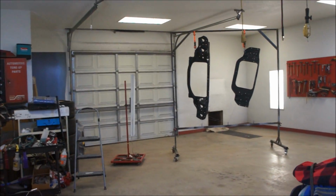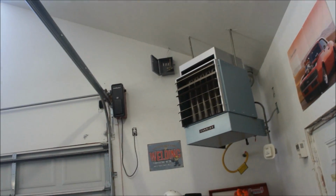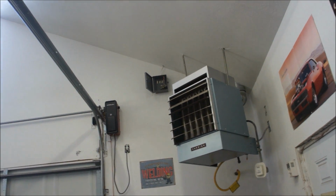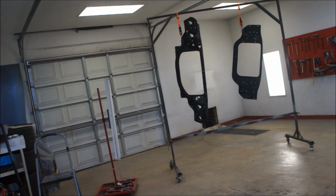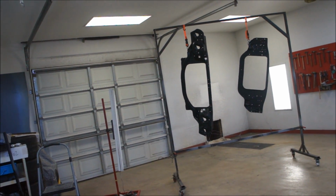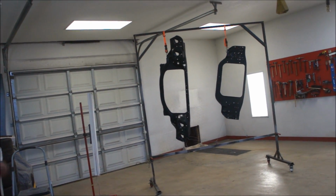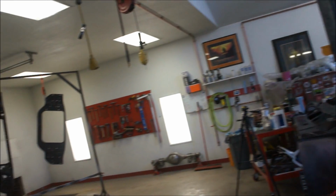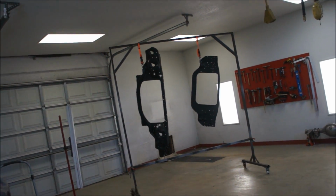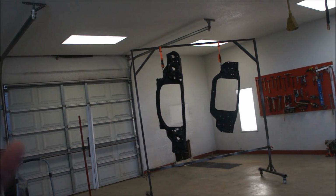All right, morning, guys. So here's going to be my issue. It's right around 35, 38 degrees outside. I've got a 69 in here, which is fine for painting, but as soon as I kick the fan on, it's going to start sucking the heat out. I can't let it get below 65 degrees in here for the SPI stuff. So, therefore, I would have to paint it, shut the fan off, and then that would probably kick back on at some point to warm it back up. And I'd have to keep that cycle going through the sealer, through the paint, and through the clear,